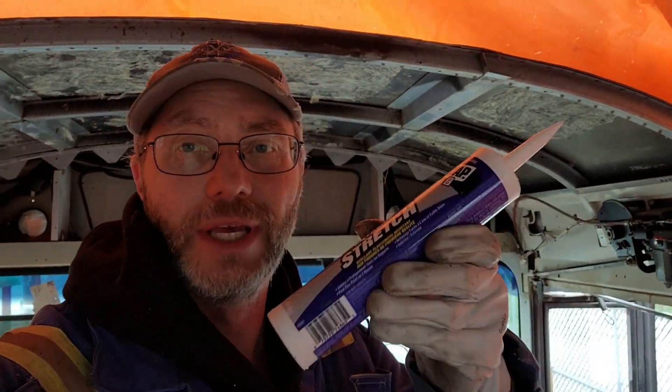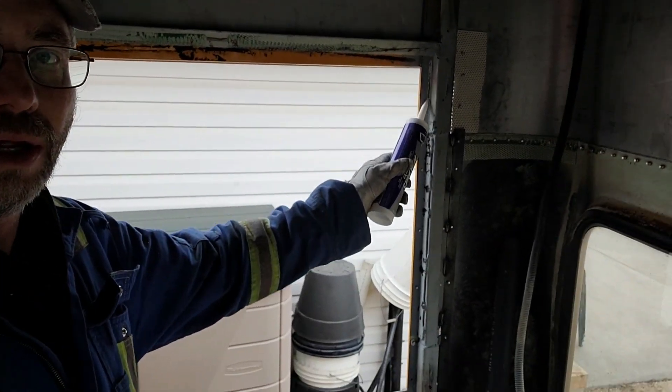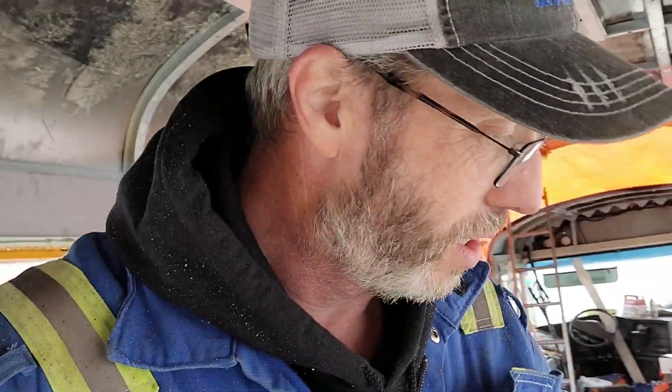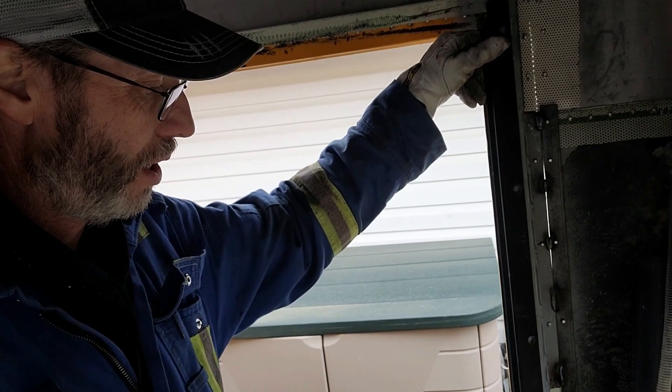The back's all done. I put the saw together and made a bunch of keepers for the tin. I'm going to start putting windows in now. Christina is on her way and she'll be here in a little while. I'm using this DAP Extreme Stretch Elastomeric Sealant — Premium Crack Proof Elastomeric Sealant. Here in Canada at Home Depot it's eight bucks or so. I'm going to put a nice thick bead all the way around — at least a quarter of an inch — and then the window goes in and these keepers go over top and you screw them in, and it holds the windows in.